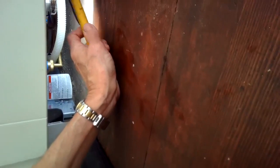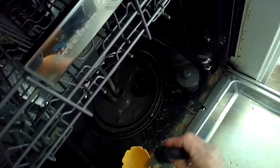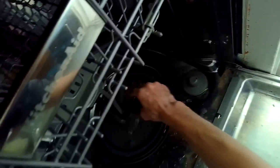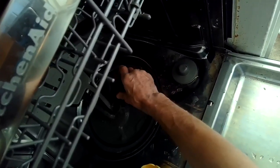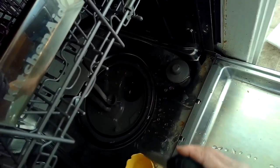The drain is actually right in front of you — you don't even have to take the machine out of the cabinet, and can do all the work right from the front. You want to make sure it's unplugged or you turn off the breaker. Then we're going to ladle out all that water that's in there, because I want to take off the drain hose and make sure there's nothing caught in it. If you remove the drain hose with water in here, a lot leaks out the bottom, so it's good to ladle it out. I use a turkey baster to grab any remnant water at the bottom.